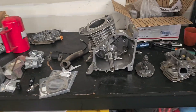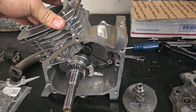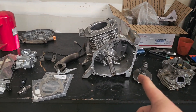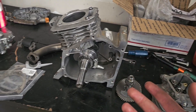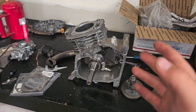This works really well because it actually fits the frame, but a lot of people say, oh if you do it like this it'll blow up instantly. Now there is some truth behind that, but I want to go over how you can mount your engine like this without it completely grenading. After that I'll go over these little goodies I'm adding to this engine that also apply to any other 212 engine.